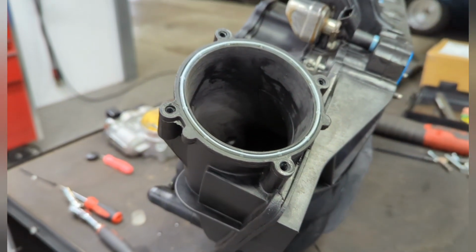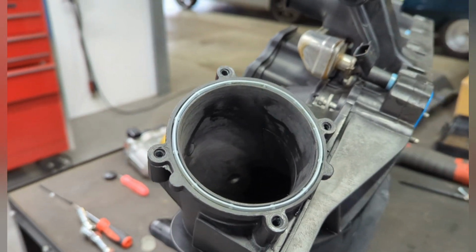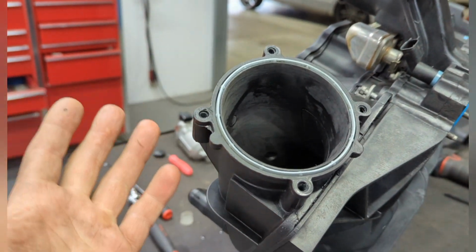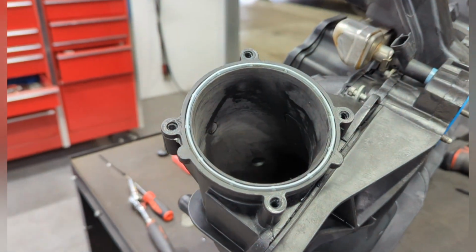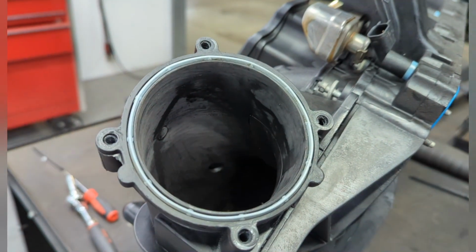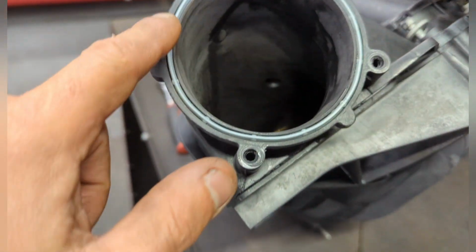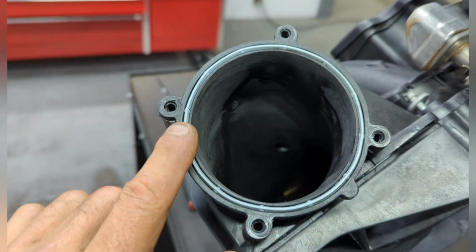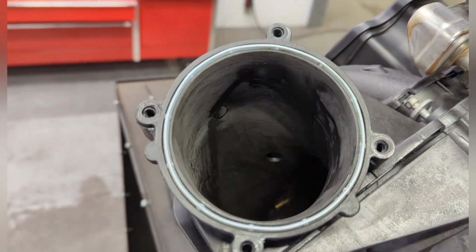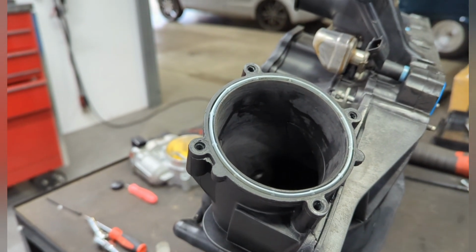So if anyone out there has a manifold and they want to send it to us, I'll happily buy it off you. I just can't really find one at the moment, so I would like to get in there and mow it right out with a wood bit, and wherever you pop through, continue on, and obviously find the thicknesses and bore it right out, because if we can make it another 1.5 to 2 mils bigger over the whole area, that would be handy. But what we've done is we've ported it out. It's actually tapered, and then it tapers back to an oval. So we've really worked in the area, and look, we have increased it quite a fair bit. So pretty confident we should see something happen there if it requires it.